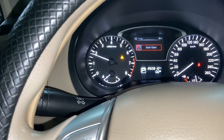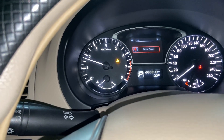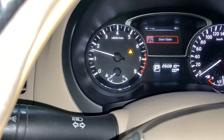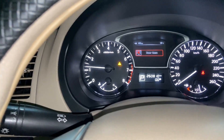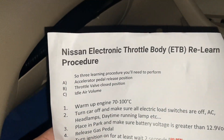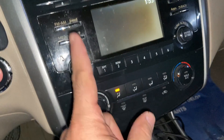What I experienced was that after I stepped on the accelerator, the car's RPM started to rise, and after waiting for five minutes it returned to normal RPM. This is my first time cleaning the throttle body valve, so I was prepared to do the relearn process, but the fifth generation Altima does not require the same procedure as the fourth generation Altima or other models.